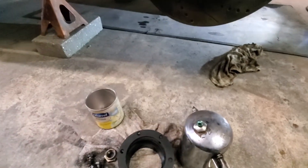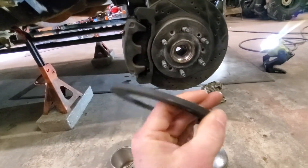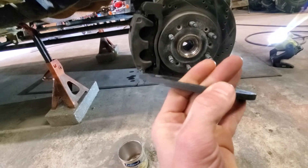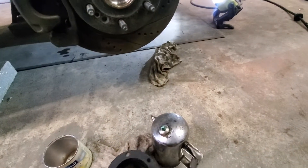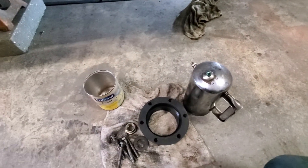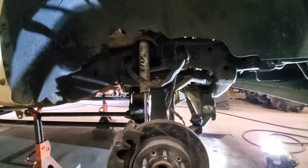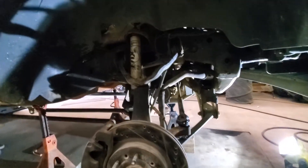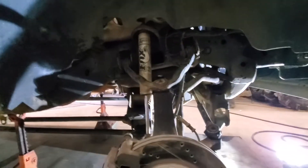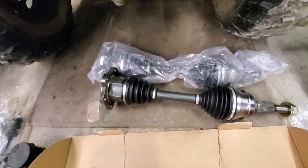To help with that, I had these spacers from my Tahoe — I got four of them, they're a quarter inch each. I'm going to stick one in and try it out, to give a little extra room so it's not pulling hard on the inner joint. At full droop it is definitely pulling on it pretty well, not yanking it but there's noticeable tension.